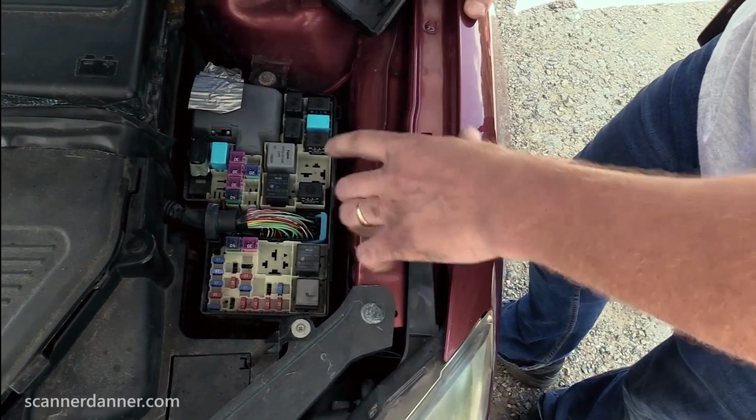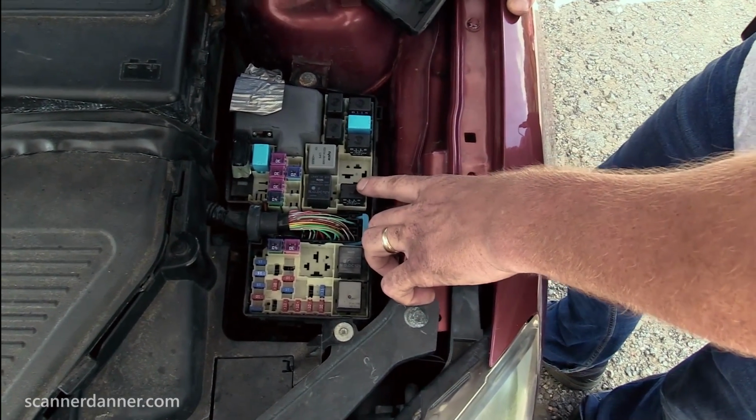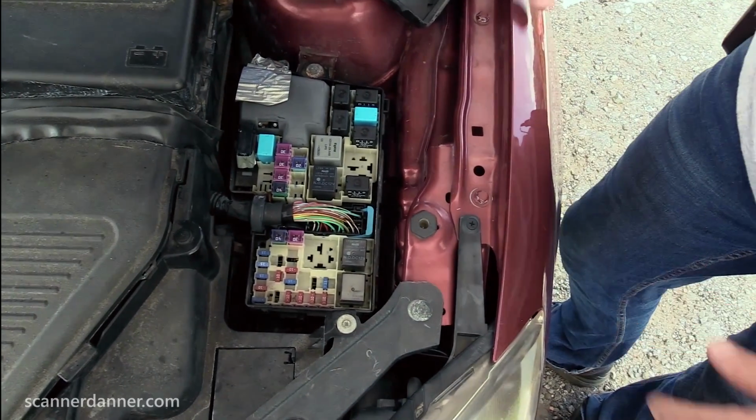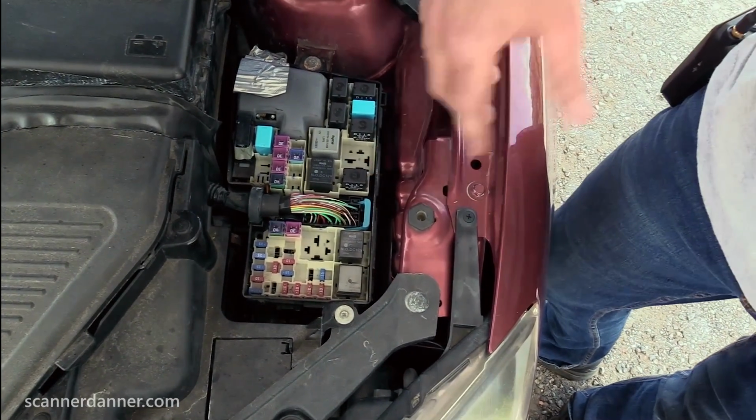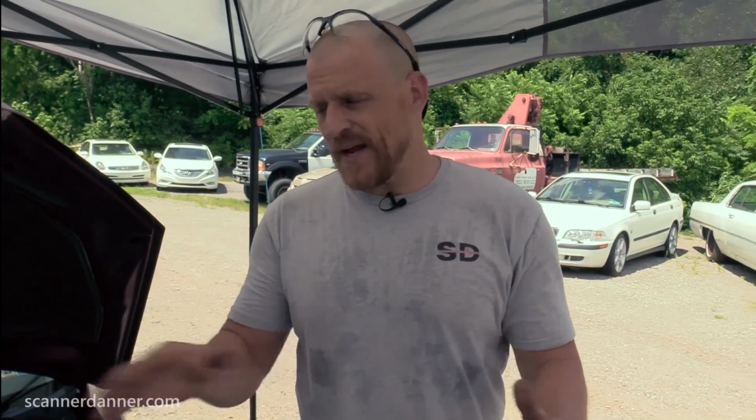Another one, because this is a newer vehicle, it's computer controlled air conditioning, is I can connect my scan tool and see if we have any fault codes, and I should also be able to see inputs. So inputs with the scan tool, we can verify things like the AC switch. Is the signal getting to the computer? Are there any fault codes related to the system? High and low side pressures potentially, depending on the design and if those inputs are available. So really scan tool is not a bad way to go.